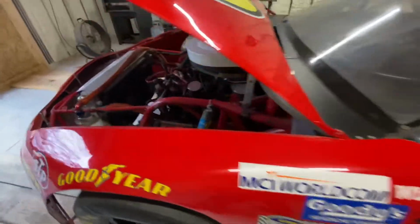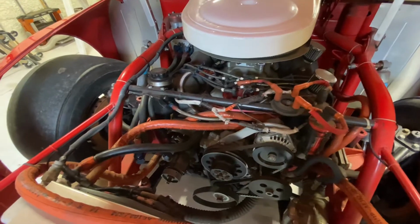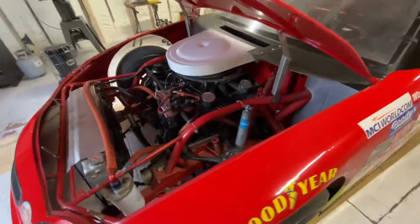Once that oil temperature is up to 200 degrees, I come to the front of the engine and remove this belt from the oil pump on the front, and I put an air ratchet right here and rotate this oil pump clockwise for about a minute, minute and a half, and it cycles that warm oil from the tank into the engine. I was told to do that before you start the car, and then obviously put the belt back on the oil pump before I try to start the car, and start the car up, and it runs great.